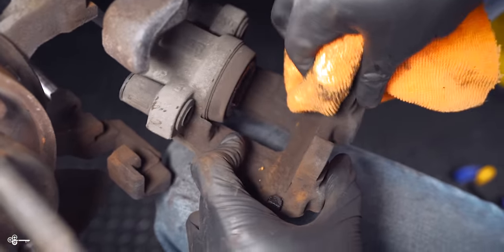So what I'm going to do, you'll notice that these brake pads have a little cutout in them, is if I take the one in the back, all you need to do is just press it into place. Okay, just like that. And then I can put this back in my bleeder valve. Then we're just gonna reinstall our retaining spring. Okay, just like that. So as you can see, not only does it look incredible, it's going to perform amazing, and also I'm super excited about less brake dust while still having the performance.